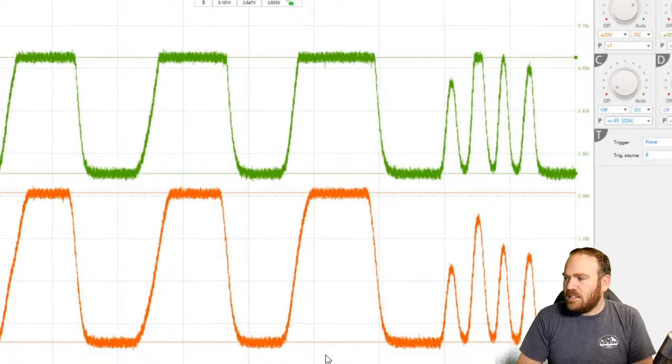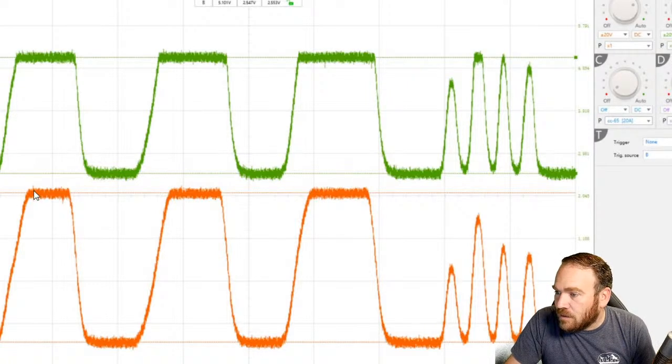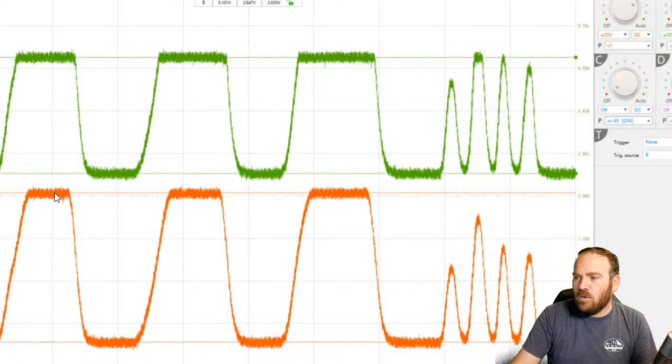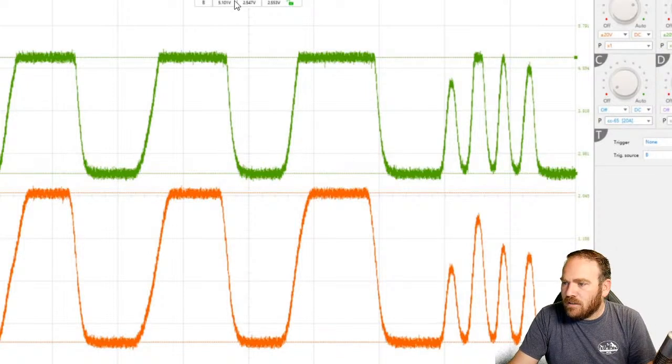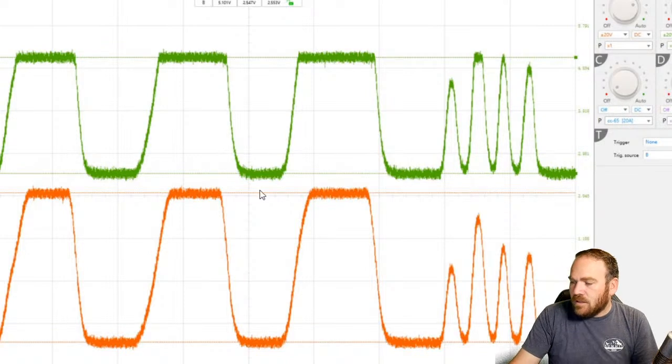And then week 19, TPS 1 and 2, full throttle blips, and then some rapid on and offs. So this one, let me see what our measurements are. One goes up to 4.3, the other one goes up to 5.1. So they're not exactly the same, and the starting point is different as well. Let's see, the one starts at 2.5. Is that right? Yeah, that's kind of strange.